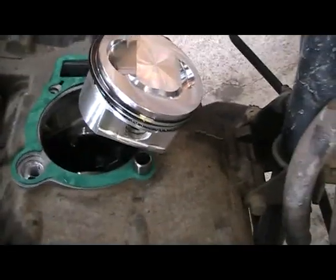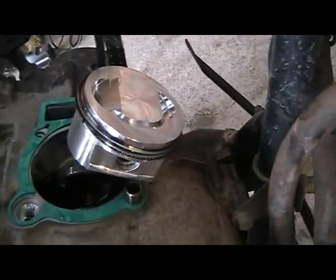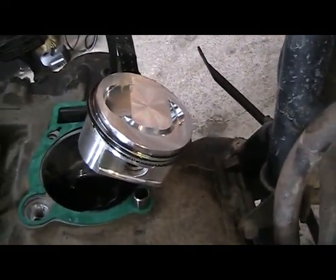Also don't forget your cylinder alignment pin. Put your new gasket. At this point I've checked everything — rings are indexed, the oil or lube is in. Be sure to wipe some lube in the cylinder. We're ready to put the cylinder on.